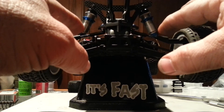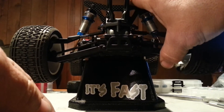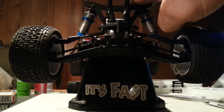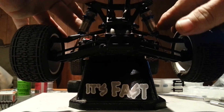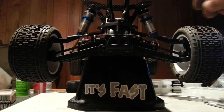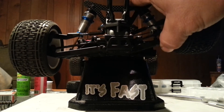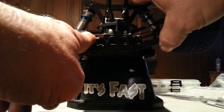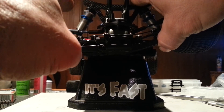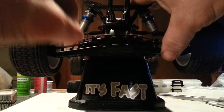What you've got to keep in mind, if you want to get a good test, is watch this — it's matching. But the anti-roll bar is on there. If this shock seal is bad and this one's not, they're still tied together. I can actually stop one side or the other just by pulling one back. You can see this is the black anti-roll bar — that's about all the strength it's got to lift that shock. You don't usually notice that if you've got springs on it, but you don't realize just how much work that anti-roll bar is doing.